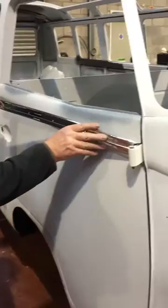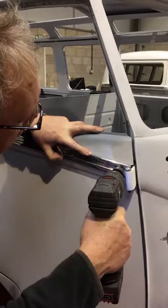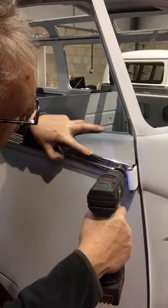Although the screws would pull the trim to the door, it's good practice to get a snug fit without the screws. It's better to undercurve it three times than overcurve it once. We are initially going to use four screws, spacing them approximately equidistant apart. When you're happy with the fit, use a 2.5mm drill bit to drill and secure the trim against the top door hinge.